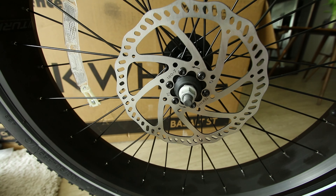Just feeling this torque sensor out. On pedal assist 5, it's definitely a torque sensor because I can pedal very lightly and it's giving me power at about 13 miles an hour without just flooring it all out. On a cadence sensor at pedal assist 5, it would be boosting me up to top speed basically. If I put in a little more effort, I can feel the power ramp on.